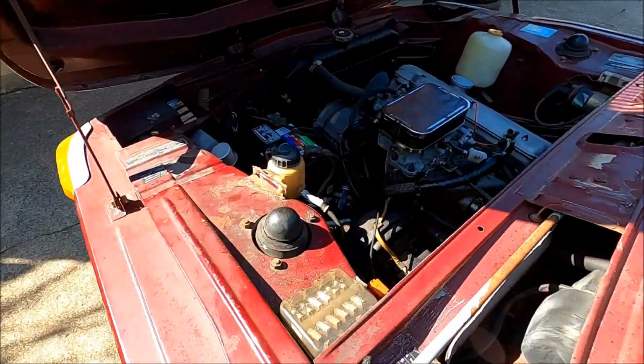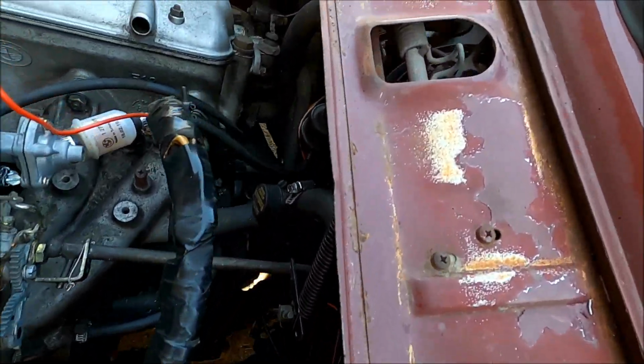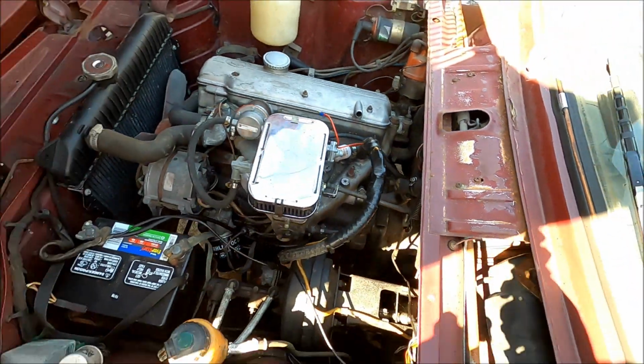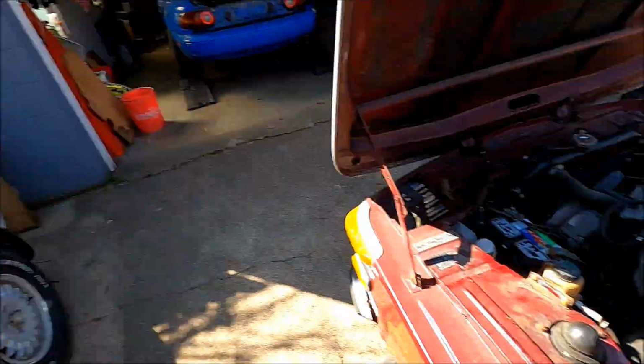And whatever this noise is, it sounds like a hissing coolant hose. I think we need to bleed the coolant system better. I just topped it off once, put the cap on. So we'll sort that out. But I would call that a very successful first drive around the neighborhood.